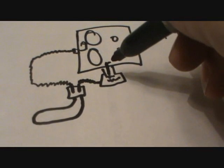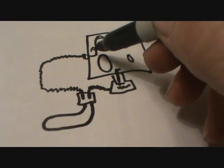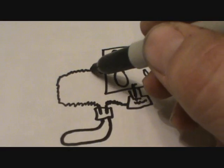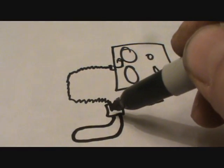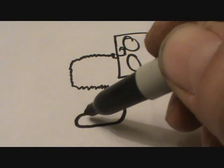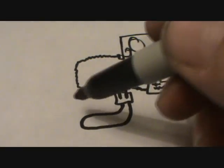And when the engine starts running, of course, it gets a vacuum signal at idle, so it starts pulling fresh air from this source here. Comes down through here, comes around, enters one side of this heat stove. This is down in the intake. It's actually in the exhaust crossover on a V8 engine. We are referring to a V8.